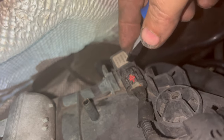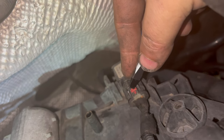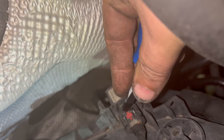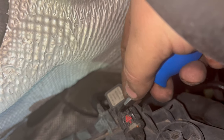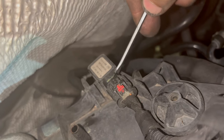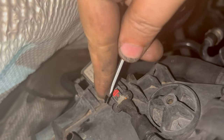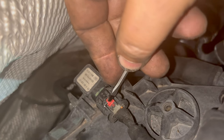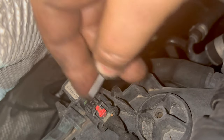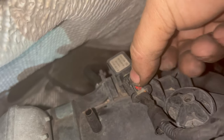This is your manifold absolute pressure, or MAP sensor — again, Chrysler's fun two-stage lock. These two connectors aren't difficult. There will be other two-stage locks in this job that are going to be annoying as hell, but these aren't them. Two-stage lock action — squeeze and pull — it's not difficult if you put your hand on it correctly.